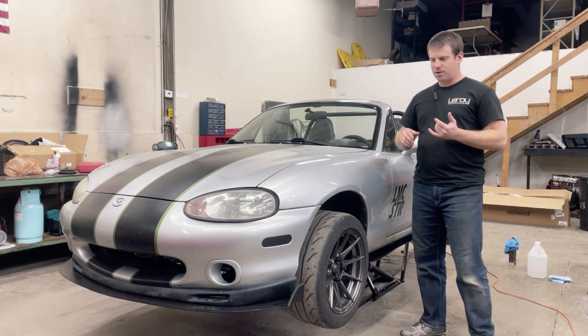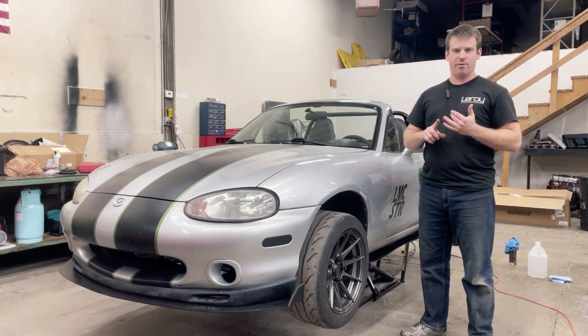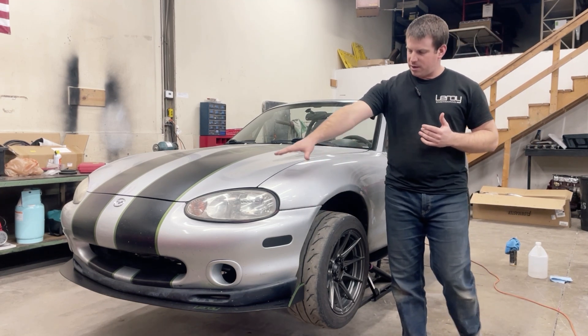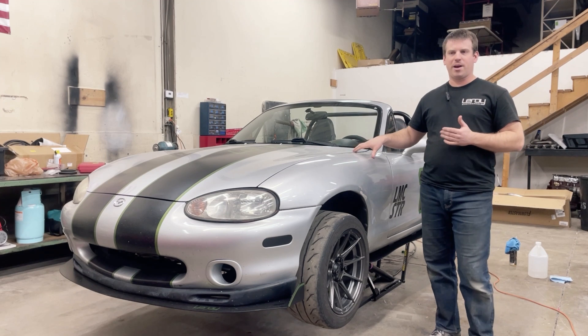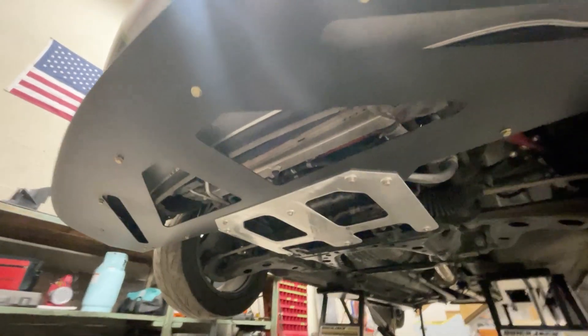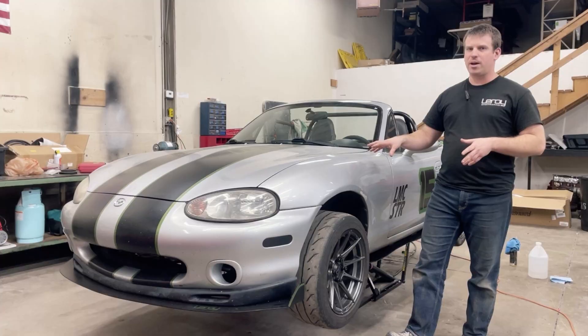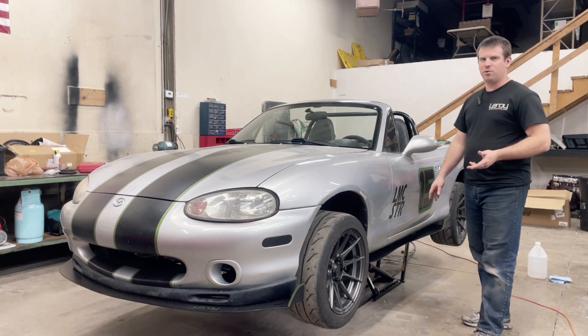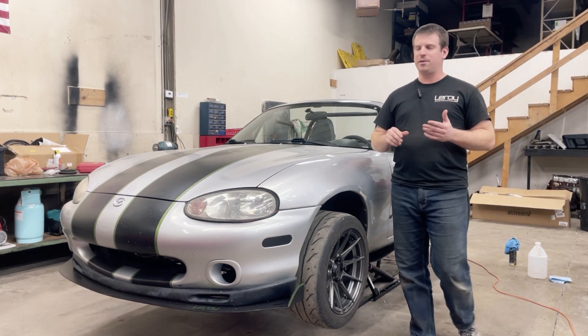The goal is to keep weight down first, and to try and keep cost down. It's not a full skid plate all the way back — there are big holes lobbed out of it to keep the weight down. I didn't want something super heavy. The whole front splitter right now is just about 10 pounds, which is pretty good for how solid it is. The skirts I haven't weighed, but I think they're probably like two or three pounds a side — very, very light.